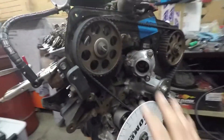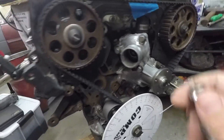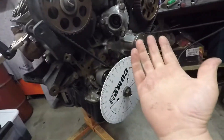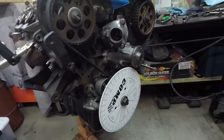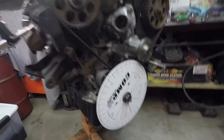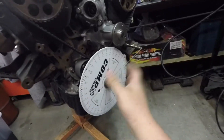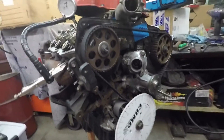One thing to note: since this is a dual overhead cam engine, what you can do is take this piston stop that we made up, stick that in the number two cylinder hole, do the same thing where you come up on it and come back around on it and get that zeroed up for number two. Once you do that, you can get this exact same setup replicated over on the opposite side and verify that cam — at least on number two in that case — has the exact same grind as the opposite one. Just for peace of mind, if you want to go through that tedious process, it's not a bad idea. It's easily repeatable — you just have to do it for each cylinder, whichever one you want to do it on. Hopefully this will help somebody out. Enjoy.